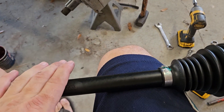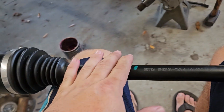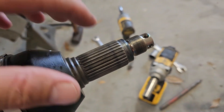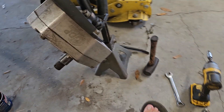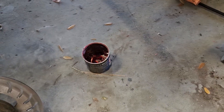If I was going to do the RMAC shock conversion — which I'm still waiting on by the way, they're back ordered — this axle will help me get some more travel out of the front. I'll have to put one in the other side too soon. One thing to remind you guys: always grease your shaft before inserting into the portal box. Grease the crap out of this because that's what keeps the splines alive. That seal doesn't do anything for the splines, so grease it really good with some thick red grease right there.